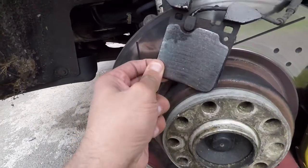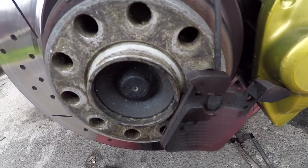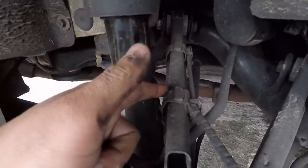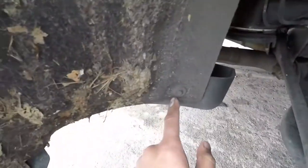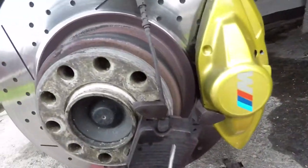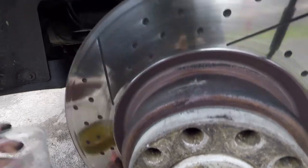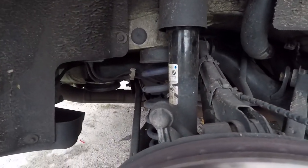On the driver's side — passenger side in the US — here is the rear brake pad wear sensor. I'll be reusing mine, but if you're replacing it or break it, the wire comes across here along this arm, then goes down the back subframe. You'll need to remove a 10mm plastic bolt and an 8mm bolt to access the connector box right here — just unplug it and plug the new one in. I'll do this off-camera as I need two hands.